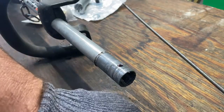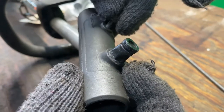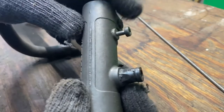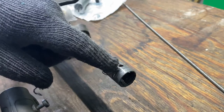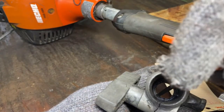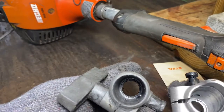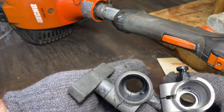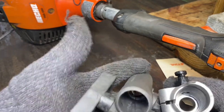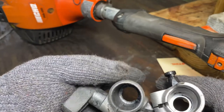When you put this back together, this screw that you removed from here that sticks through the sides should engage into that hole. What I want you to notice here is that lip — you see how much of that lip is there. When you put it up to the next one, it may be hard to tell in the video, but that one is way smaller of a lip than that one from the wear.